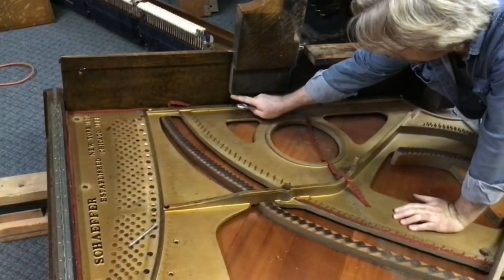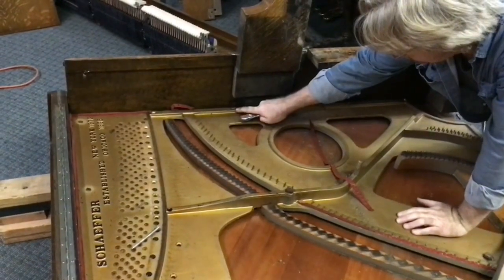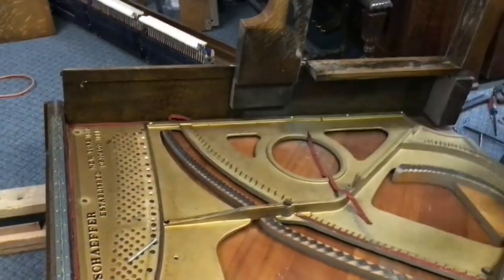Got those out. We're going to do a little something different for this one right here, because even if we use this tool setup, it's going to come up and strike right here and prevent us from getting it out. In some cases I'll raise it as high as I can and cut it off with a hacksaw, then use vice grips to raise the stud the rest of the way out — cut again if I have to. However, with this being so close to the edge, I'm simply going to chisel a little bit of this wood away right here to enable me to get that driver bit onto it.